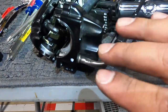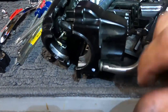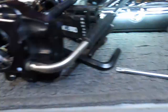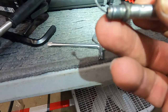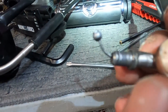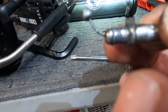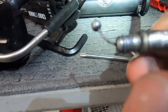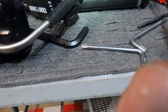Got the throttle cable situation figured out. It's hard to show while holding the camera, but essentially you pull down on it, wiggle it around, and eventually it'll pop out. If you look at this one, there is a little retaining clip in there. As you push it in, because it is tapered, it'll get through the hole and once it passes through the clip opens up a little bit. It also looks like it might be tapered on the way back — so as you pull and wiggle, you compress that little ring and it allows you to pull it out.